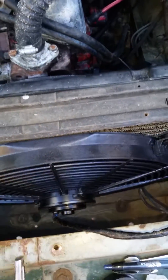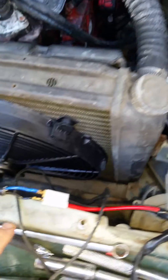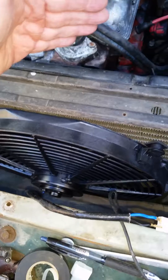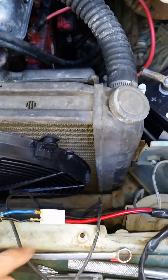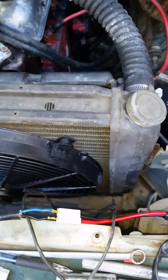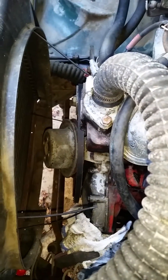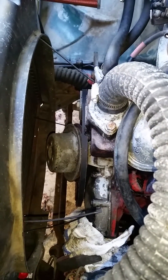It has a wiring harness with a blue and a black wire. It depends on whether you want to push the air through or pull the air through — you can switch it around. I've chosen to push the air through the radiator so it'll all be nice and hidden. I've removed the existing fan, so I'll put some bolts back on there and tighten that up.